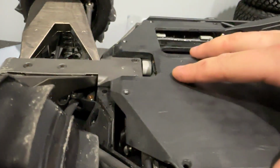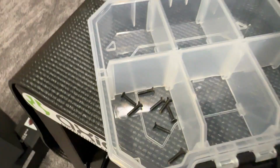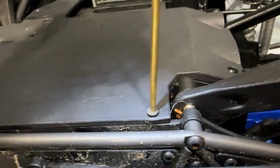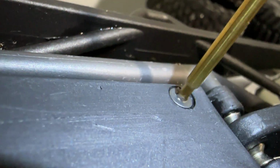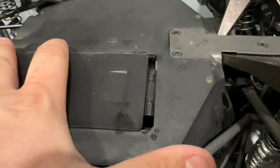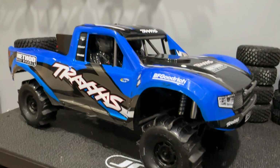Alright, next step after that is just sliding this cover back on. You just want to make sure it's flush right here. There's a little lining tab. And then I would just go around and make sure all the sides are down where they need to be and lined up. Next, reinstall the 7 2mm bolts into their respective holes. After that, you can put all your tools away because all that's left is slide the battery cover back on. And now you've replaced your pinion/spur on your UDR.